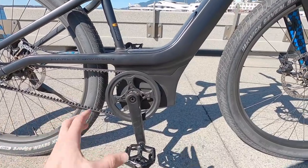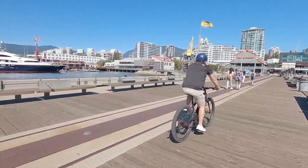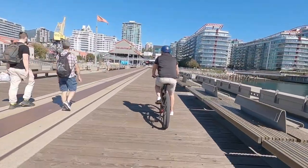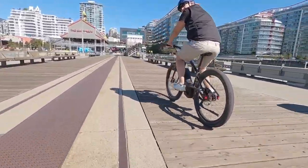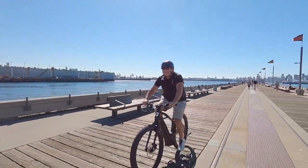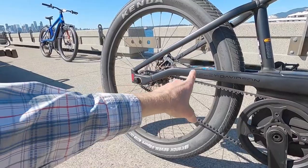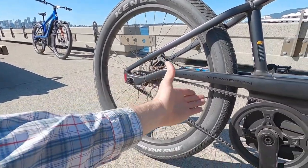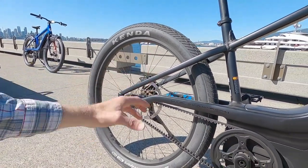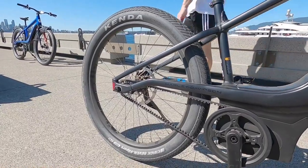The battery placement is a little chunky visually, but it improves handling and stability, and from what I've experienced riding it, it's feeling really good. Initially I wondered about lower clearance, but visually you can see the chain stay is a bit higher. They've done that so you don't need a break in the frame but can still use a belt drive — avoiding the cost and strength compromise that a frame break can add.